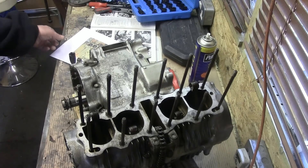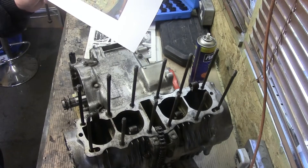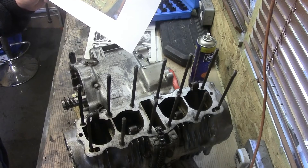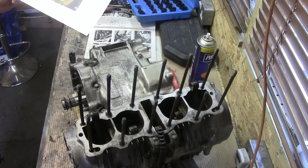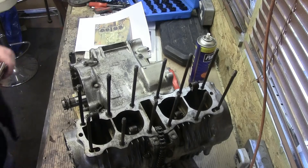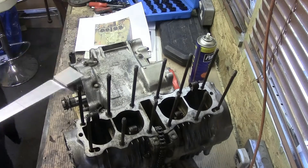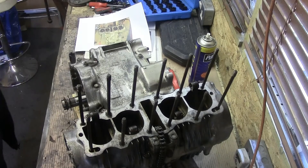I'm going to take off all these bolts now. I've got my little diagram, as I did with the head bolts - I'm going to take them out and measure them for length and their position on this diagram, and I'll put a still of that on so you can see where they come from. So here we go - these are all the top crankcase bolts to come out, then it has to be flipped over and all the bottom ones come out. Although there's no slackening or tightening sequence for these top ones, I'm just going to use basic principles of going sort of across and around rather than just taking them round, so there's no stress on the case. I'll do it until I hear the click, then I'll take them out one each separately and measure them.